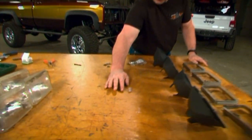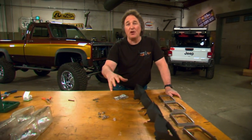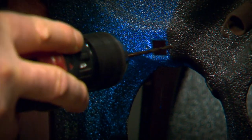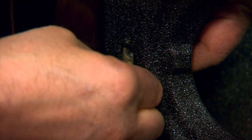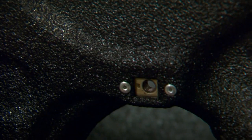Now when you're fitting your headlights, you're going to find that these little plastic adjusters are notorious for breaking or pulling out. It was just a bad design — they were always a problem. You can get replacements, but that doesn't really solve the problem. What we're going to do is replace them by riveting in a metal insert that we got from A.R.P. This will give us a permanent solution to a long-standing square body problem.